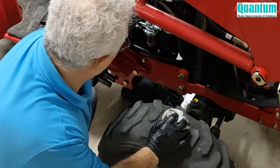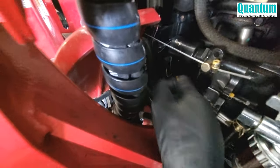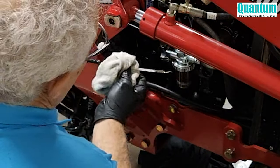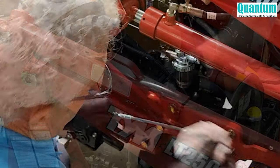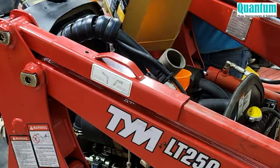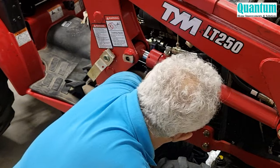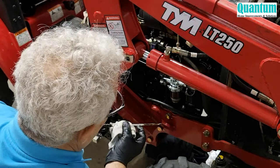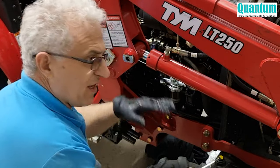It's a bit hard to get the dipstick in — it's just behind the oil filter so you've got to get right inside. The mark for full is just there and you can see it's about 10mm below — I'll just put a touch more. I'd say that'd be plenty. Just checking the oil one more time — beautiful, just over the mark. By the time the motor starts it will fill up the oil filter and the level will go back down again.